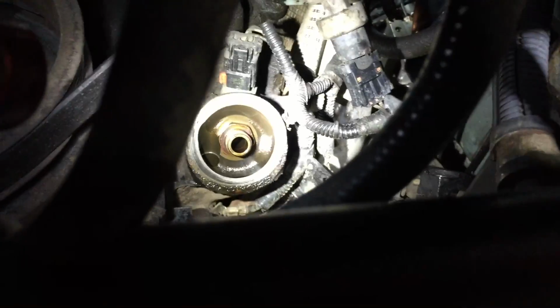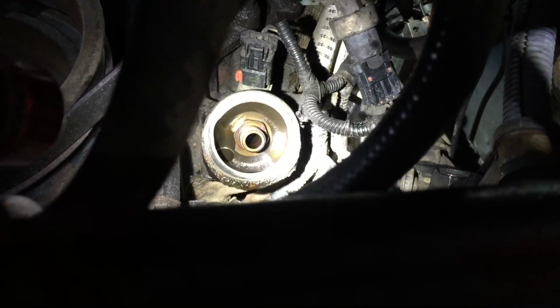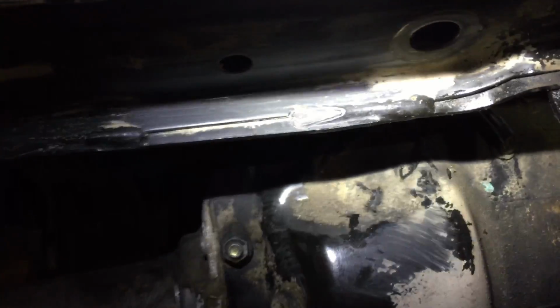And first of all, we took the oil filter off to give us some clearance. So remove it, and then there's a plastic drain trough under the oil filter. You'll see there's a bolt that holds that trough on. It's a 13mm socket for that. And then over on the driver's side, there's a 10mm bolt. Get that plastic trough out of there.